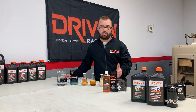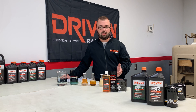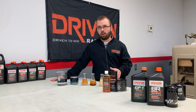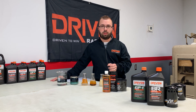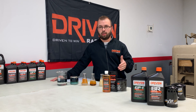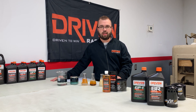Make sure you clean everything properly and check with your parts manufacturer on the proper cleaning process. Most parts are shipped with a protective film that you need to clean off. However, some roller lifter manufacturers pack the bearings with a particular grease designed to mix with the oil — that's there to provide lubrication at initial dry startup. Don't clean that out; follow the manufacturer's guidelines. You don't want to use brake cleaner or solvents and remove that packed grease they intend for startup.